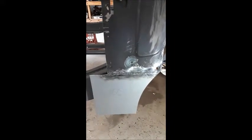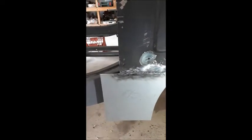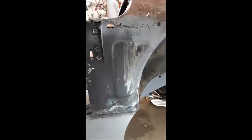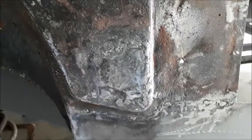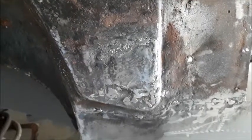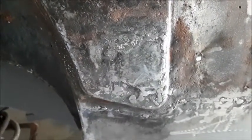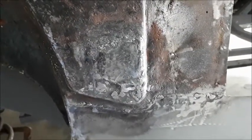There's the other side done now. I actually put a whole new panel in there. Got to tidy those spot welds up at the top — that's all oxy. Just ran the wire wheel over it, no grinding or anything. Pretty happy with that. I went over that with the oxy and tidied it up a bit — looks a lot better. A bit down the bottom looks worse than it really is, just heat marks. I'll put a little bit of metal filler in there and make it look nice — not that you'll ever see it. Vast improvement over the MIG.